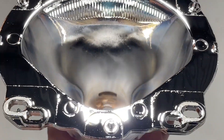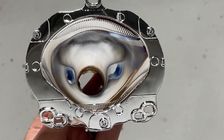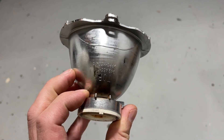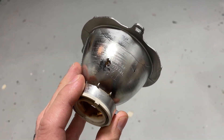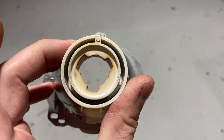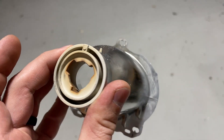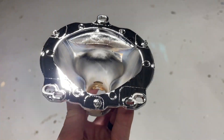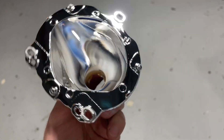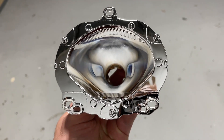It looks like my suspicions were correct — we've got a fully burnt-out projector bowl. You can see it's lost all the chrome reflectivity in the upper half of the bowl, and that's what creates the hot spot. Some projectors just don't do well with HID systems. If you've followed us, you may have seen ZKW projector conversions where it just burns right through. The brown spots in the back aren't necessarily an issue — we've seen these on a lot of similar projectors — but the only way to find out is with a special camera or by taking it apart.